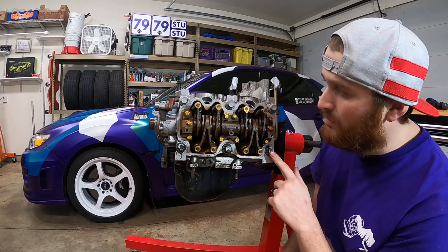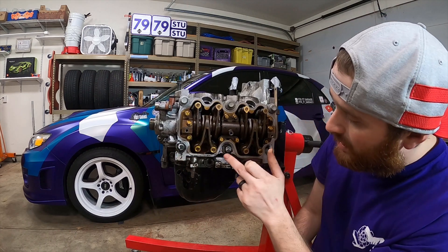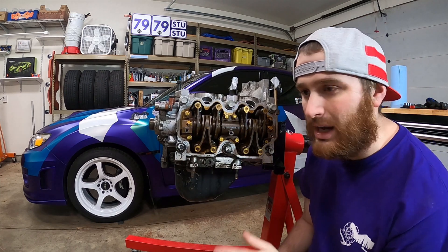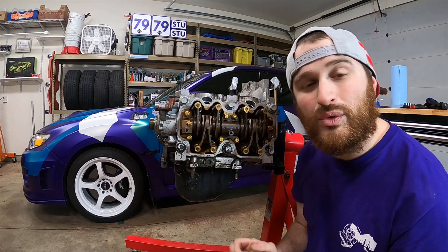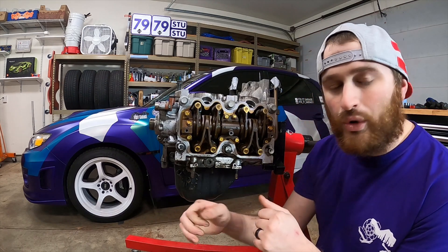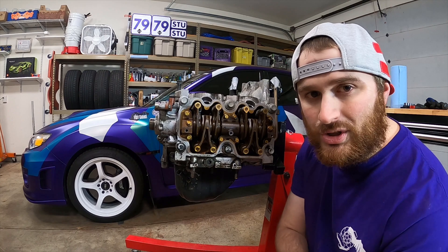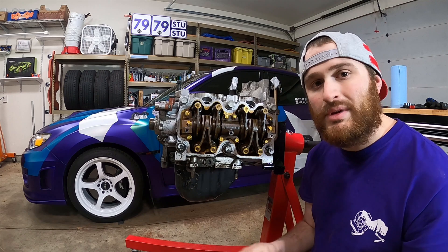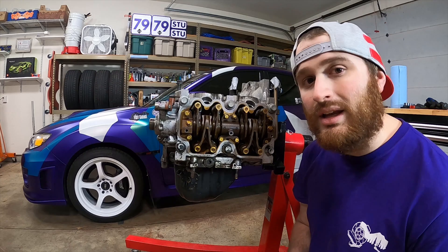So what you're going to see me do is loosen this bolt, that bolt, that one, that one, this one, and that one will be last. You always want to start from the outside in and go in a crisscross pattern to evenly release the tension on the cylinder head. Sometimes they'll even tell you to only move them a quarter turn at a time. These ones it's not going to be as big of a deal since they are getting machined, but sometimes — usually when you're dealing with certain kinds of engines — you need to loosen them in steps. So always be sure to consult the service manual before disassembling any kind of engine.